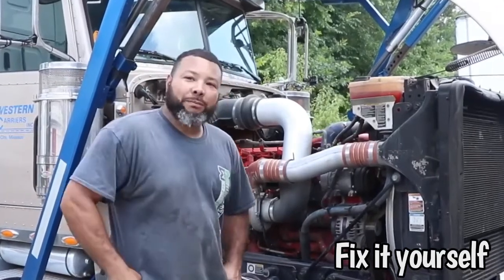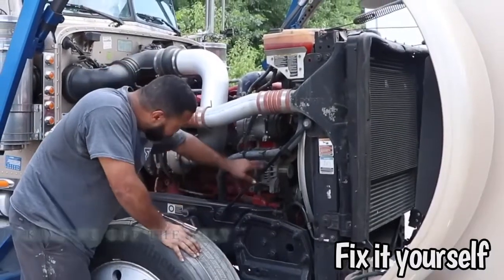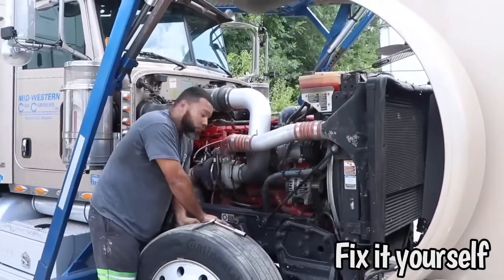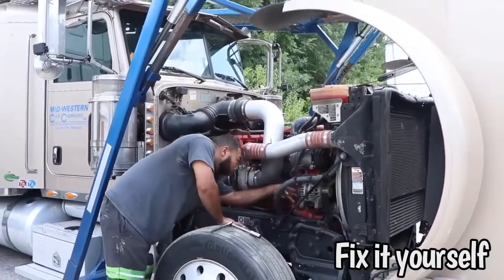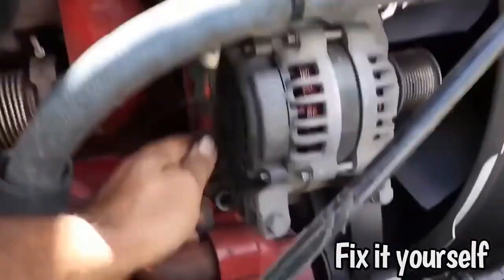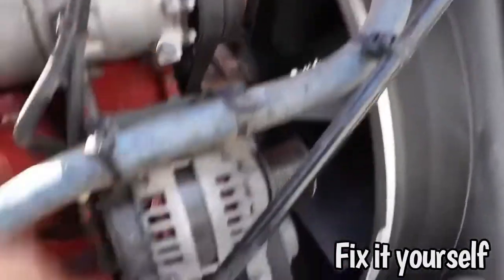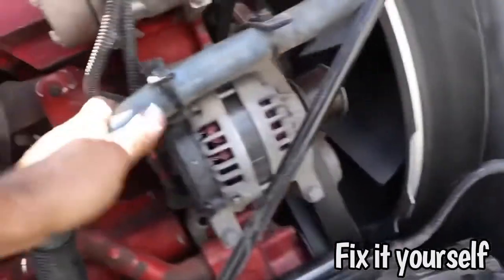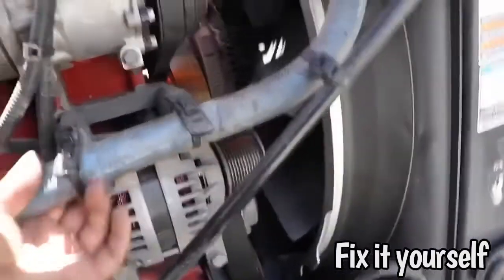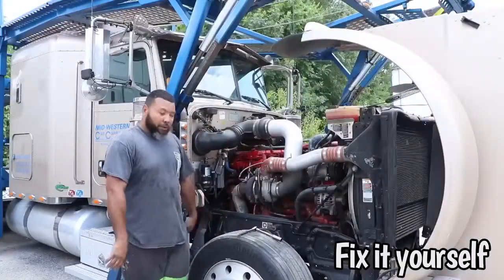Today on this episode, I'm going to show you how to change out my alternator. Once I take the belt off, I have four screws that need to be removed. But before I remove those four screws, I have two lines that need to be taken off. So I'm going to take these two lines off, put it in the socket set, and after I take these two off, then you got four bolts and the alternator is going to come right off. I'm going to cut these with a wire cutter so I can hook off this pipe with no problem, and from there put it on a brand new alternator.